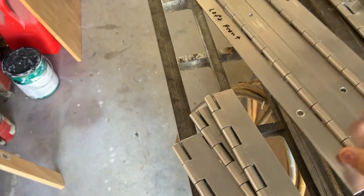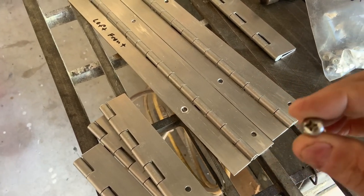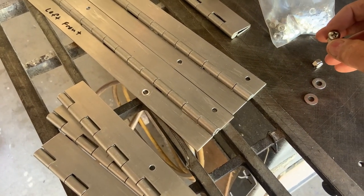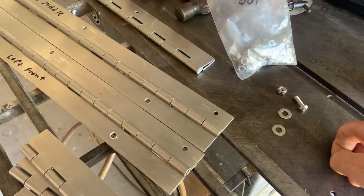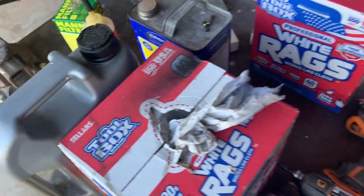I'm getting ready to go on the roof of the bus and I'm taking all the hardware for the left side. We're going to need 14 screws — I'll bring 15 or 16 so I can drop one or two — same with the nuts, and then twice as many washers. We're going to need the Phillips on the drill driver, the impact gun, a 7/16th wrench, and the drill with the drill stop so I don't accidentally drill a hole into my solar panel. I'm going to use a battery drill, not the air drill.